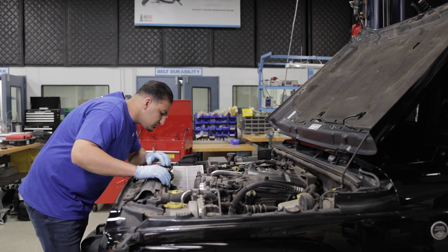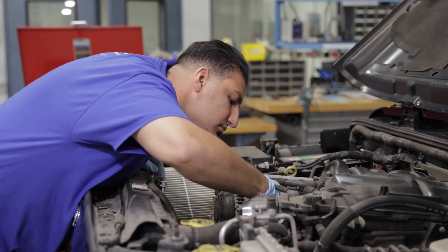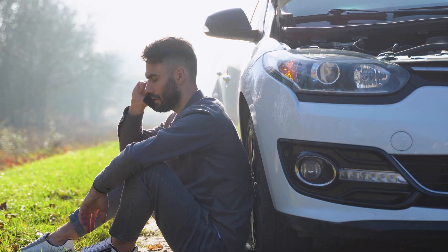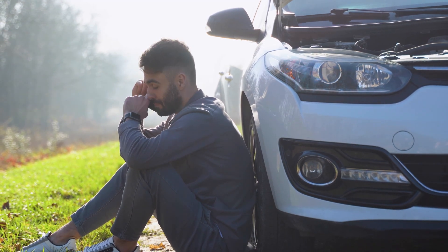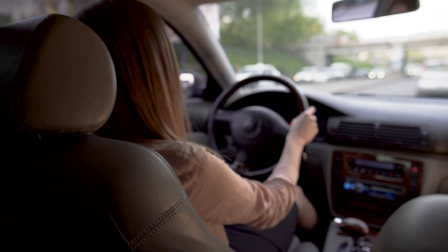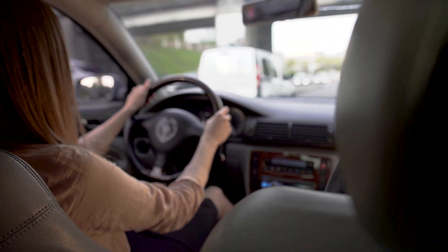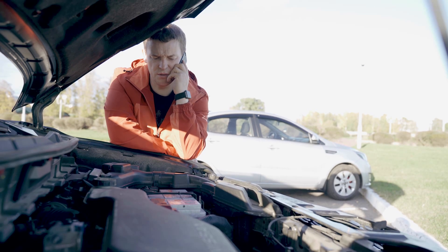The second installation error is somewhat opposite the first. It happens when a water pump is serviced or replaced without flushing the coolant at all. You should always replace the coolant when the water pump is changed. In fact, 95% of water pump failures occur due to this mistake. If a customer refuses the coolant change, they're opening the door for several problems. Eventually, the old coolant will not be able to keep the engine or other vital components at safe operating temperatures, which could cause the water pump and even the engine to fail.